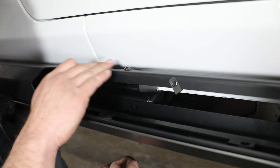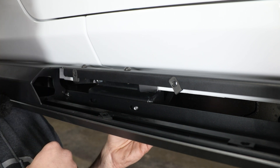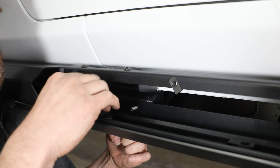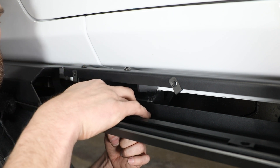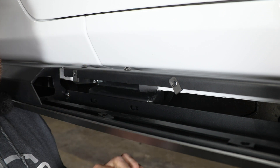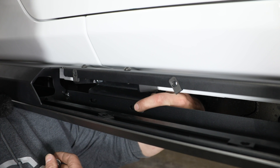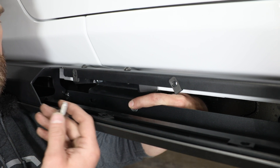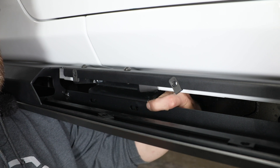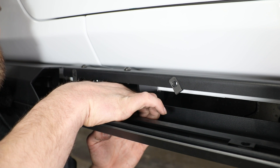Once you have all button head hardware in place along the top holding the slider, move down to installing the 5/16 hex bolts. At bracket locations two and three you'll have easy access through the step location — push the bolt through and install the nut pretty easily. However, at bracket location one it's already boxed in, so you'll need to take the nut, fish it over the back flange, push it over and line it up with the hole before reaching in and installing the bolt. It's that same 5/16 hex bolt with a washer and serrated flange nut.